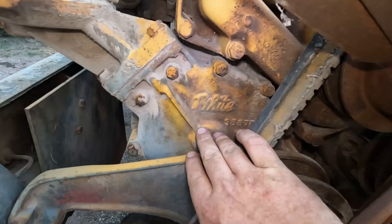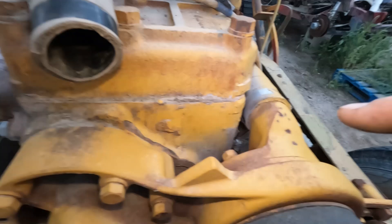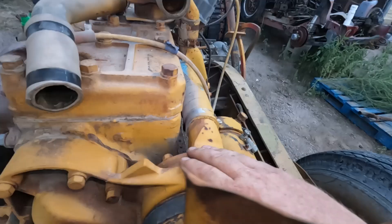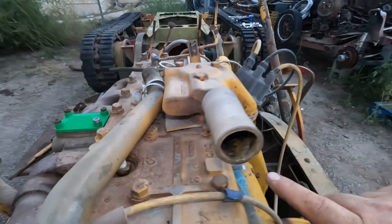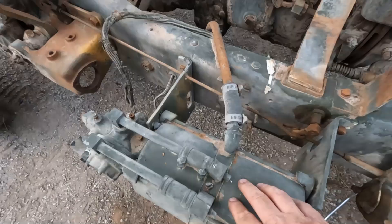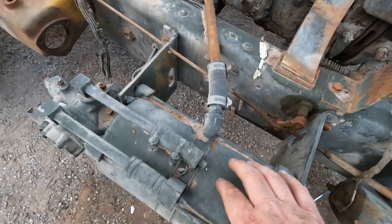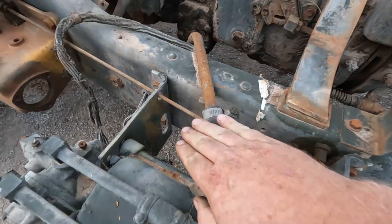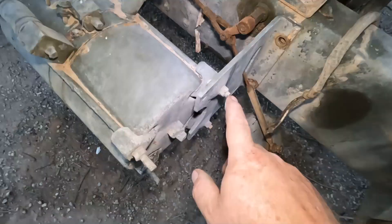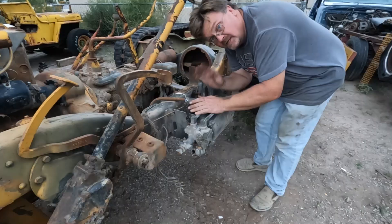It's interesting how the timing gear cover is actually bolted directly to the oil filter housing, so that's bolted solid on the motor rather than being bolted separate with hoses. The water pump inlet — the water pump is off to the side of the motor and then it goes to something over here. I'm not really sure what that is because this up here looks like a thermostat housing. This might be some kind of heat exchanger between coolant and oil to equalize the temperature. Now I need to take off this hydrovac — the rod that connects the brake pedal all the way to the trailer brake controller actually goes through the brackets, so I have to take all that linkage out first. When I was taking off those nuts, it looks like they just snapped off on both of them — I didn't even put a wrench on those, it just fell off. Since those back ones broke off, I'm just going to undo the front ones because I've got to replace them anyway.